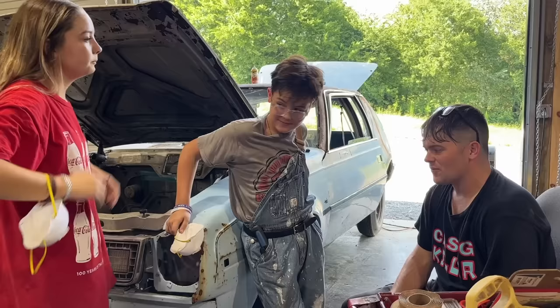It's a three-quarter inch bore. I usually tend to go smaller on the bore diameter because I've had bad luck before — if you go with like an inch and an eighth or inch and a quarter bore, the bigger the bore the harder your pedal is going to be. I like the feel of the pedal being a little softer, that's why we got this. It's got a simple single line hookup. On the Malibu we tried to run one like this with just front brakes and we plugged one of them, and it built up pressure back against the plug and wouldn't allow the master cylinder to push down as far as it needed to — we really had brake problems with that Malibu.